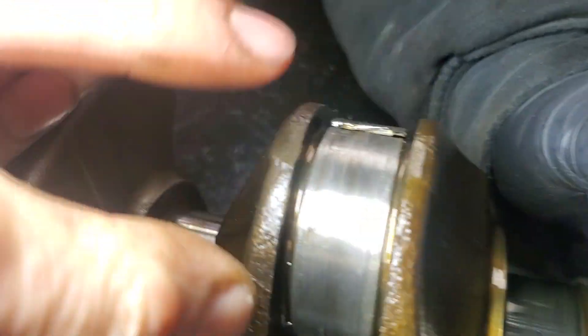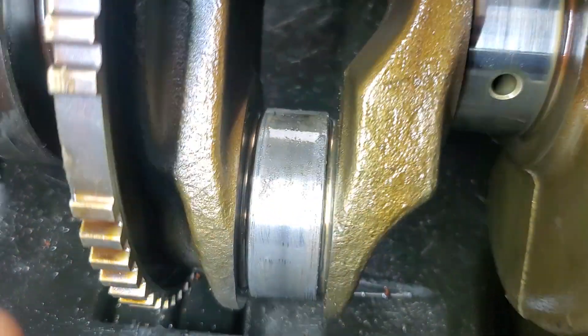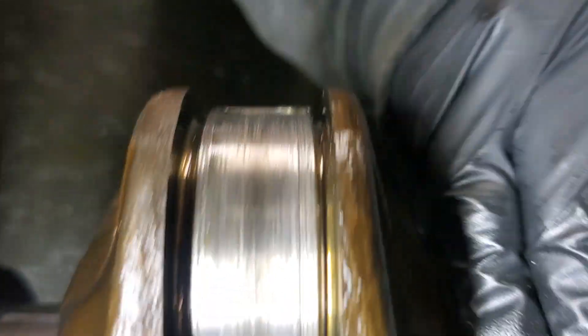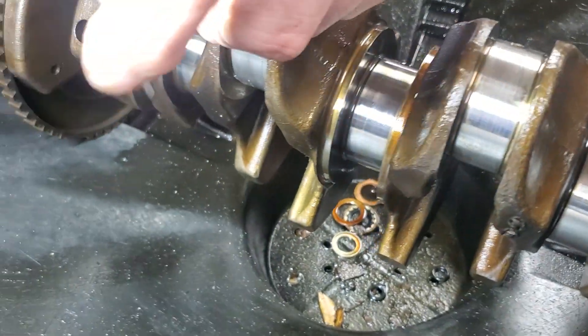So, as you can see the scoring on this bearing here? Let's get in there — now we see the scoring. Same with over here. You can see the discoloration as well as scoring; it's not as nicely machined as over here. This one's getting a little rough. But these are bearings which should have stayed with the connecting rod, so we're right in here.